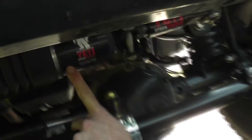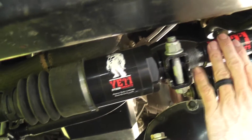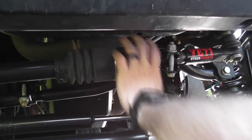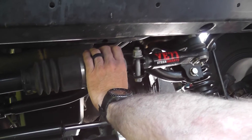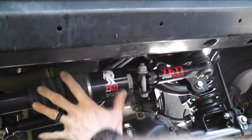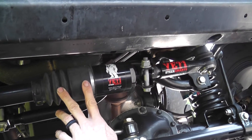And that's the heavy-duty Griffin from SteerSmarts for the Yeti drag link. I believe you had one of these for the stock drag link, which is quite a bit smaller. It replaces the adjustment sleeve on the factory drag link. This one is designed like 10X — it's much beefier to handle the forces associated with the heavy-duty drag link.